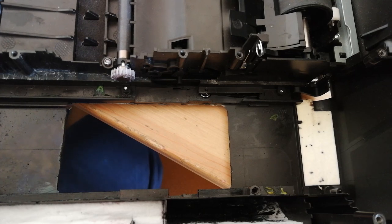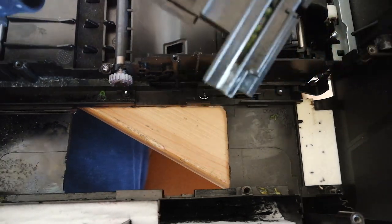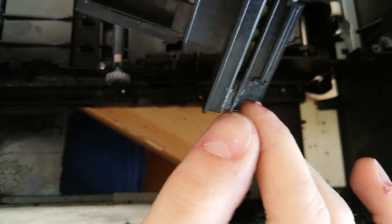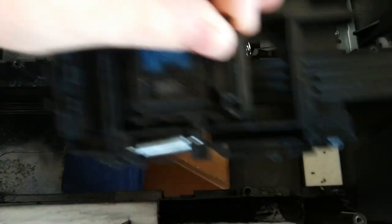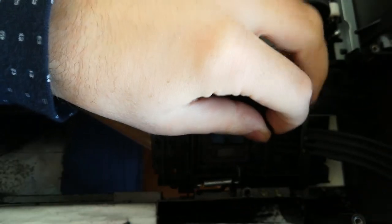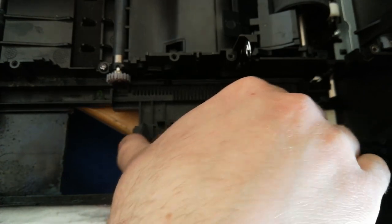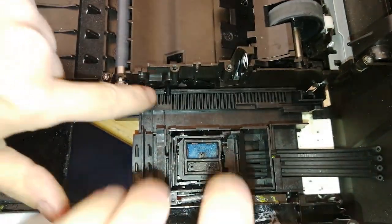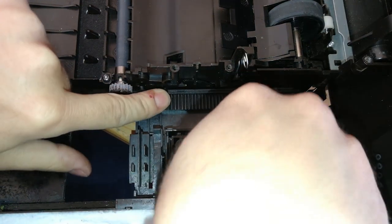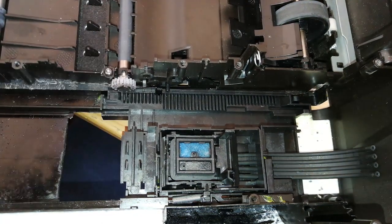It's not quite 24 hours, but I feel that the epoxy I put on this pad has cured. As you can see, this is the little raised slot I made — it's totally hard now. To insert this back, we need to get it in from the back and right side first, then drop it inside here, paying close attention to this part over here — it has to enter inside. That is the paper pickup system. Now we can lower this, and as you can see, now it's working — it's engaging totally fine.